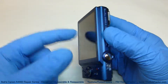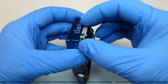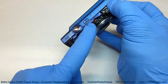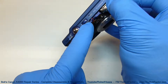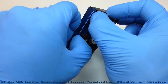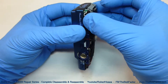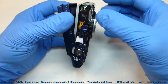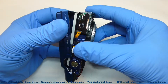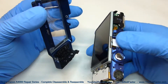To remove the back piece, we need to separate them down on this end. Just pull the inside out just a little bit and hold your finger on it to keep pressure on it. Then come down here and lift right on the edge with your finger, because there's a catch down inside. Just lift up on it — you'll hear it kind of pop — and then tip that inside piece out. Once you do, tip it out and then pick straight up, because there are a couple of plastic pieces down here that are interlocked with it.